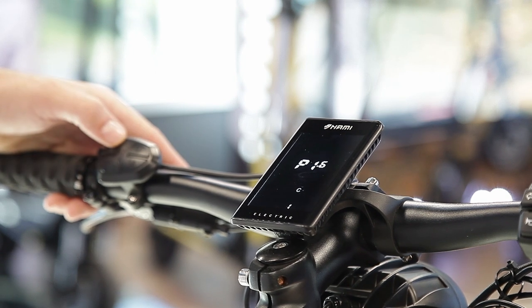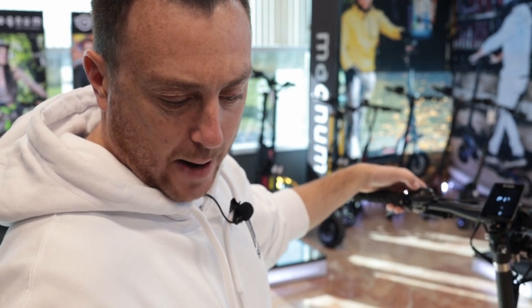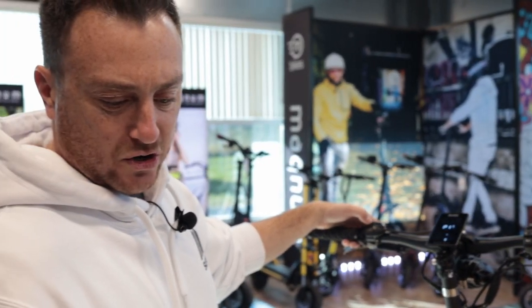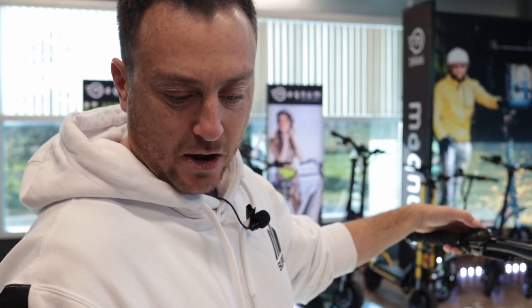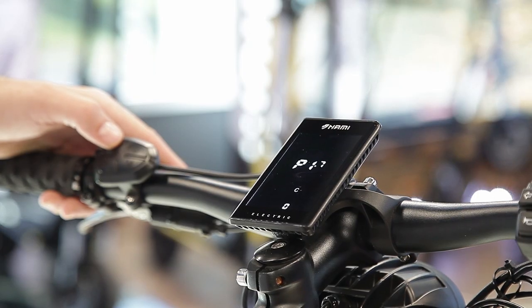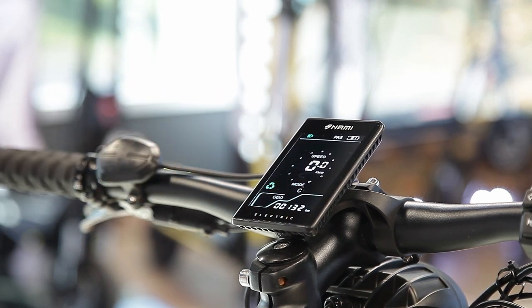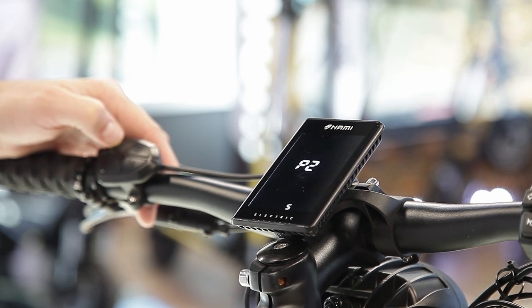Finally, P1-7 is the turbo adjustment, ranging from 0 to 5. This turbo setting gives the scooter 12% more top speed at maximum. 0 deactivates turbo mode; 1 is the weakest turbo setting. Once activated — if controller temperature and battery charge are adequate — the turbo pictogram appears on the display. You activate it by pressing the plus button for one second while riding, and a red turbo icon will appear on the instrument panel.